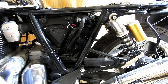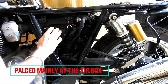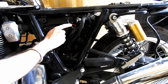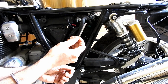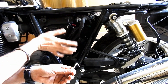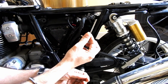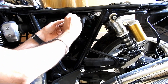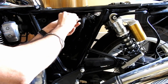So where is this sensor located? It is mainly located on the air box of our motorcycle. This is our air filter, and this wire you see here — this one — this is our IAT sensor. To remove this IAT sensor you need a 4mm Allen key, and to access it you first have to open the left-hand side cover of our motorcycle where you access the air filter. Just open these two bolts here with the 4mm Allen key.